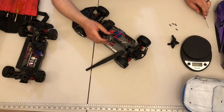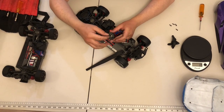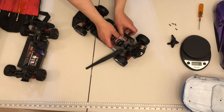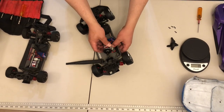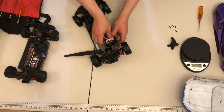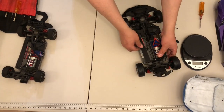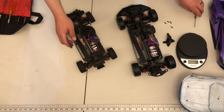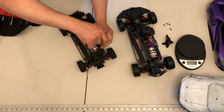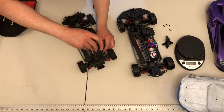The easiest way, to be honest, to count pinion teeth is if you have a marker. For example, this is black. If you have a silver or white marker, every time you count, you mark a tooth. That's the easiest way. So we're looking at about 18. So to put these back in, just stick the wires in there. You can also remove this cover. It's just these two screws on the bottom, and then you slide them in. But this will just go in there. And I'll worry about this later. I just want to get to this other pinion really quick. So we have an 18.